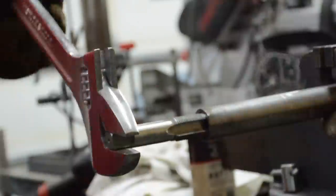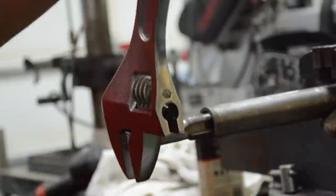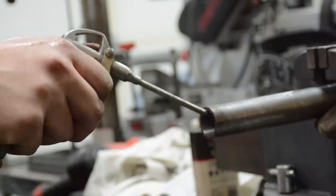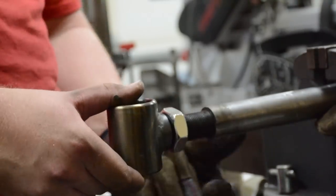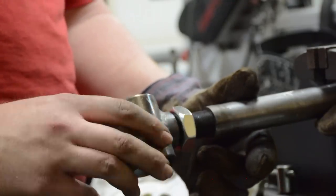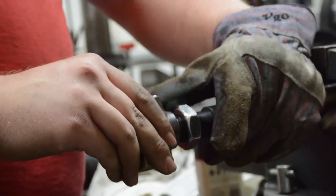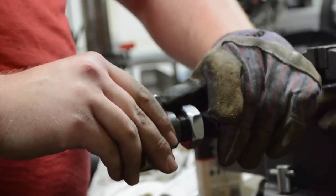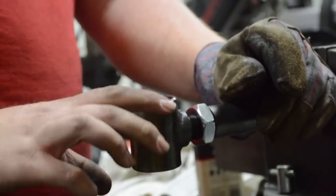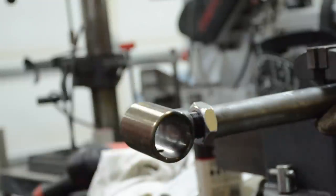I'm using a 1-inch by 14 tap, and the drill size I used was 15/16, which is the appropriate drill size for that tap. These are AVS adjustable link ends. Make sure if you're running adjustable link ends you have a lock nut on there to keep your link end in place — just check that it's turning in and working correctly.